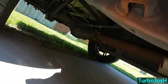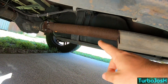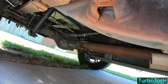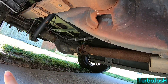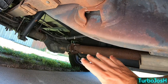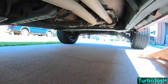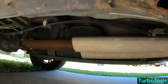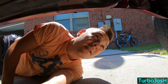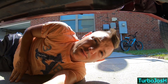Big shoutouts to Kevin — I had him weld the hangers and they just kept breaking. After about a month of them dangling, my muffler was right here, and eventually they basically ripped my muffler open. We found out that the Magnaflow muffler internals were just shot. Instead of trying to weld them closed — the walls were too thin, it would have penetrated the metal — so we hacked them right off. You can also hear some metal flapping in there, likely from a failed mid pipe. New mid pipes and a full cat-back from DNA Motoring — the cat-back was only $197, so I'm all about it. It'll sound better and hopefully get rid of that rasp.